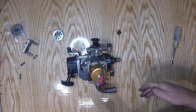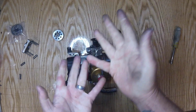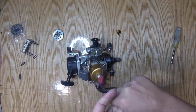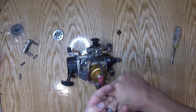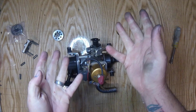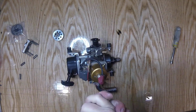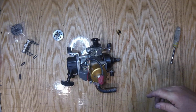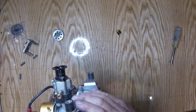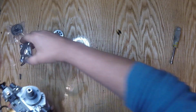So again, the pros to using the clutch, you can launch a boat by yourself. I think that's about the only one. The cons: more moving parts, which is not a big deal. It's an extra $50. It's a lot more weight. That's the biggest pinch, in my opinion. And you should use a water pump. You don't have to. I mean, you can run an engine at idle a minute or two outside of water, usually, and you'll be okay. But I would use a pump. So we'll go over that in the video, but that is basically it.